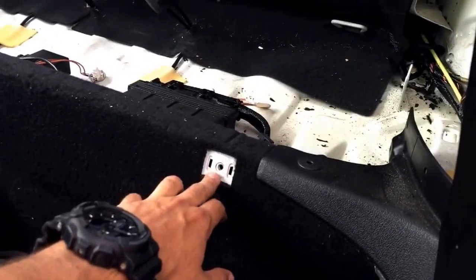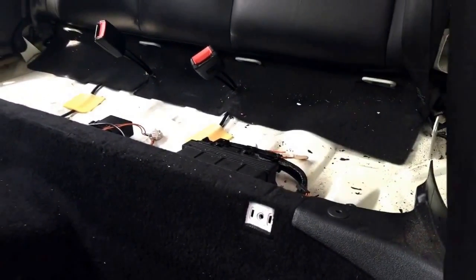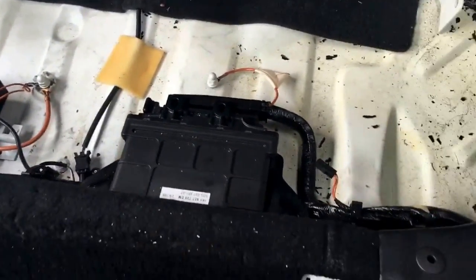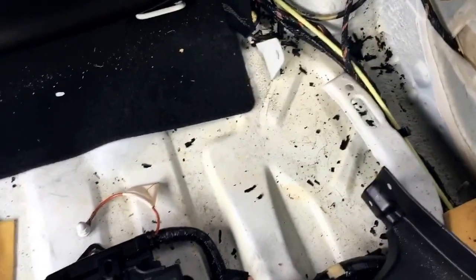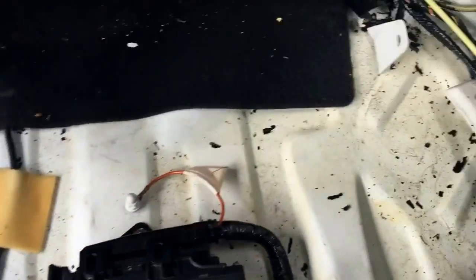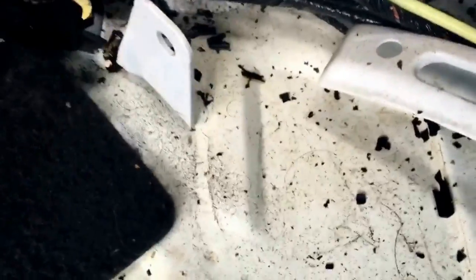I think the bolt is H5. After you remove the seat, if there's a leak back here you will see the fluid on this part — it'll be a bluish-greenish color. Whichever side you see it on will be the side the leak is on. On mine it was on this side and you can still see some residue from it.